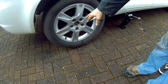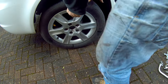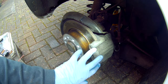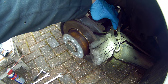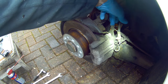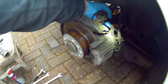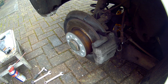I've left the wheel soaking with some WD-40 and it should be able to come off now. The rear brakes on this car are different to the front ones in that the rear caliper incorporates the handbrake cable mechanism. This is an automatic system that doesn't need adjusting, but it means the rear piston in the caliper needs to be wound back in. You'll need a tool for that which is readily available to buy fairly cheaply, and you'll need to make sure you get the right tool for the size of piston.